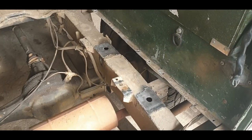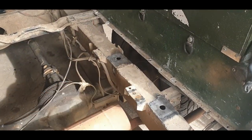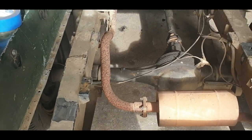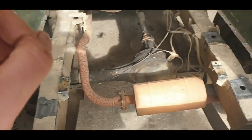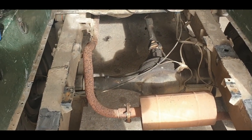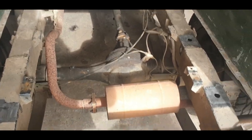The plan today is to open out these holes a little bit more so the nuts sit perfectly in them nice and flat. I'm going to clean up all the points where we're going to weld and bolt the seat frame onto the frame I've made into the chassis, mark out where we're going to be welding, clean it all up, tack it in, make sure it's all still fine, and then hopefully go for the old rebuild.